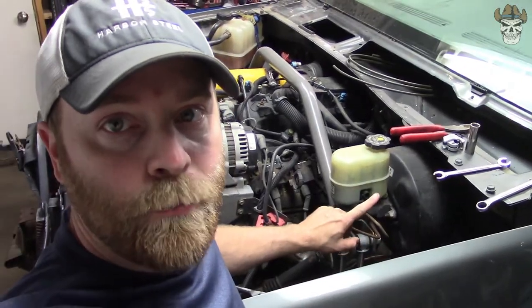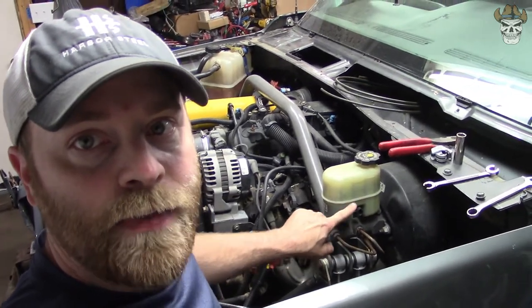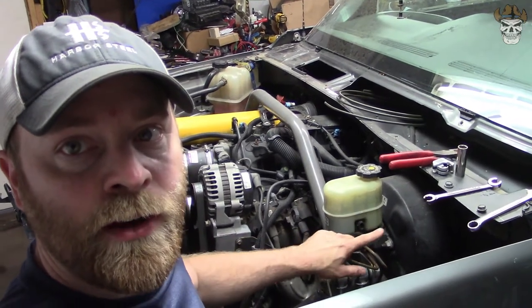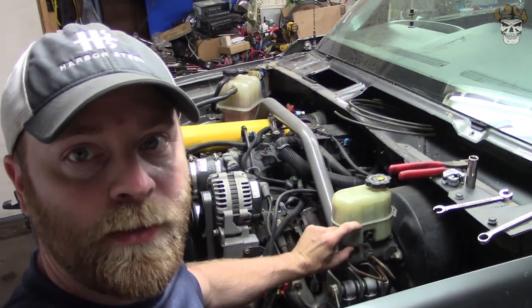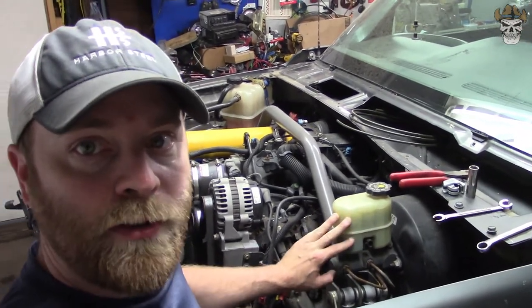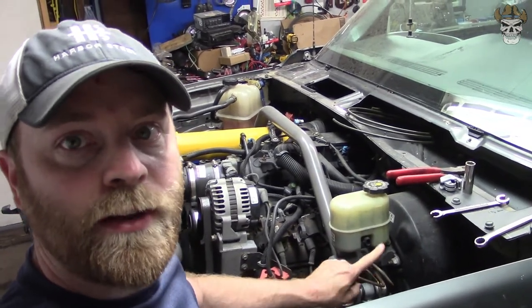As you can see, the brake reservoir only emptied in the back here — it did not empty in the front. That's because there's a divider wall in there to separate the front and rear circuits from each other. I bled out the front all the way and the rear still has some in there because I haven't bled it yet. So what I'm going to do is start removing the brake lines in the front so I can start redoing them.